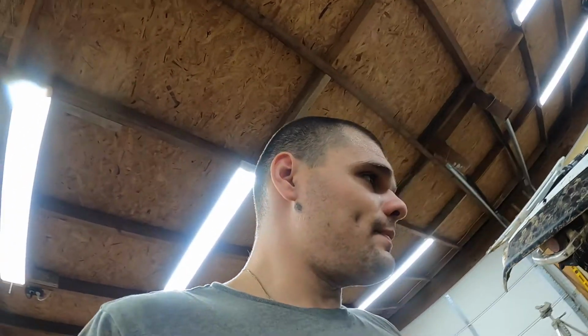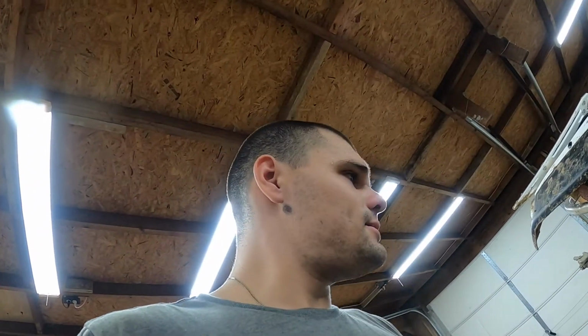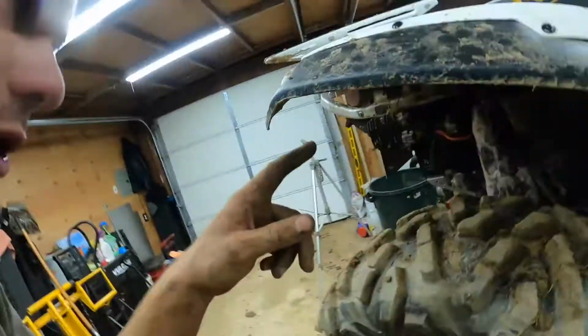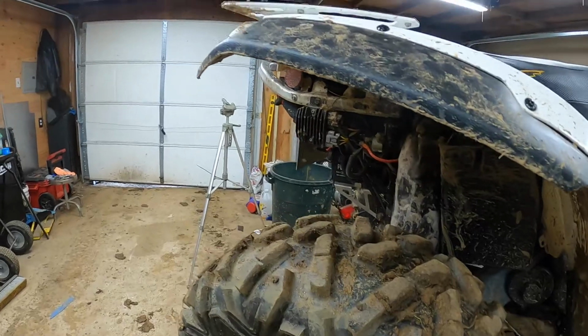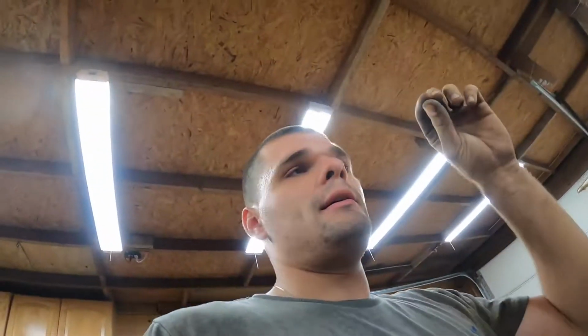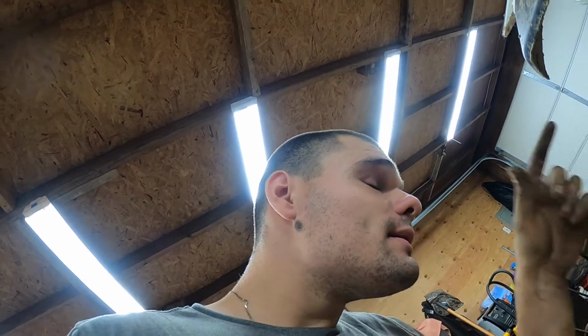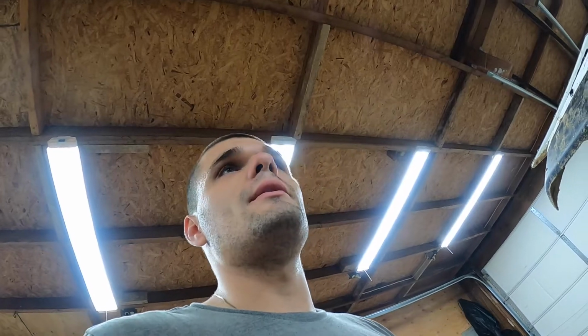And yeah, I think that's about it, YouTube. She's doing pretty good now. I had to fix a charging issue recently because I didn't realize I didn't have the charging wire going directly to the battery. I had it going to the starter relay. So that was a whole other electrical nightmare I was trying to chase.